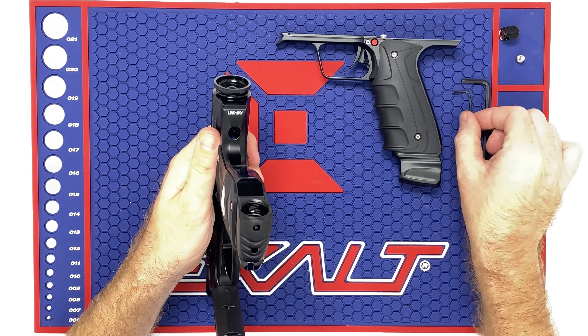Once you want to put your mech frame on, go from the front and then press it straight to the back so it locks into place. Then it swivels up and pivots up. There is an O-ring on here that has a little resistance to it, so you can kind of hear it snap. It locks into place to make sure nothing's leaking. Go ahead and put your back frame screw in. Make sure the screw is snug and that it's vertical — straight up and down, not at an angle. Don't tighten it if it's at an angle. Snug it up and once you feel a little resistance, tighten up just a little bit more. Make sure there's no gap inside the frame and you're all set.